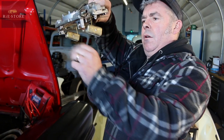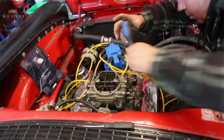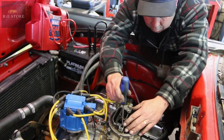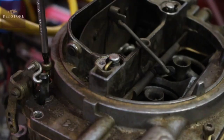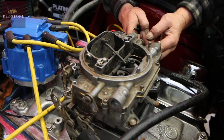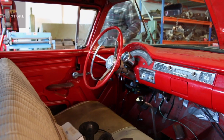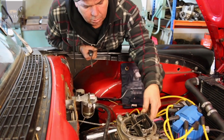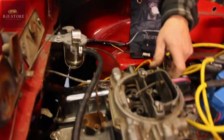The needles can't fall out. You can't force those in - you have to release these to get the down-drive needles in. Let's blow some fuel up in there. So what are you looking for? Making sure fuel is pumping through? Yeah. And where would you look? Out of those two jets - it's not a good flow, but it should be enough to fire it though.